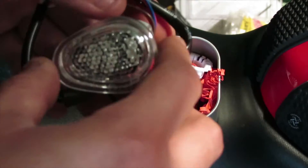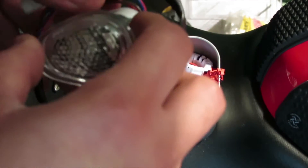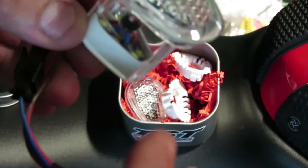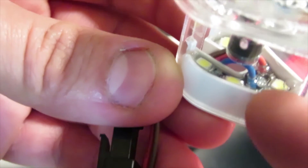The relay is a very easy plug-and-play style - you don't have to do any modifications to the bike. All you do is remove the old relay, put the new relay on, and you're all set. It's already set at a pretty decent flash rate. This is how they look, and on the inside you're going to see the LEDs inside the halo ring that will show the halo color.